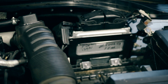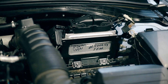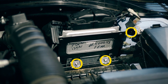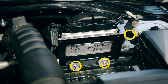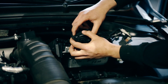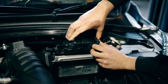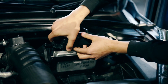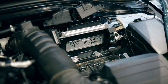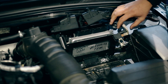Now that we've removed the battery, we've exposed the factory ECU. You can see that there's a bracket held on by three 10mm bolts — we're going to remove those bolts and remove the factory ECU. The first step is to remove the connections from the top of the ECU by pushing in the locking pin and then lifting the tab on the side of the connector, then lifting firmly directly upwards. With the three bolts removed, the factory ECU will simply lift out of its current location.